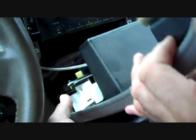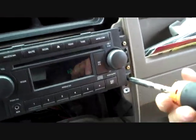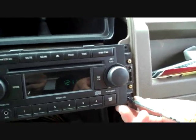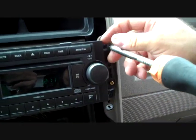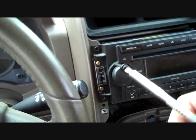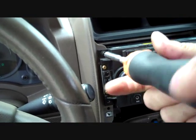This will allow us to tuck the bottom edge down into the opening to lay the panel down and get access to the mounting screws for the car stereo. There are four screws on each side — we are just removing the Phillips mounting screws. The Torx screws secure the face plate to the front of the stereo. On the left side we have the bottom and top screws to remove.